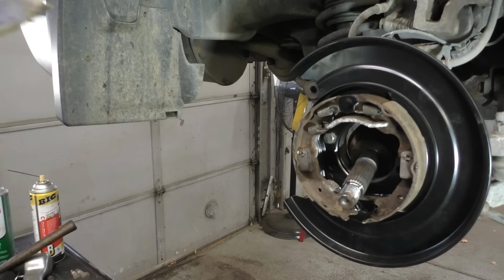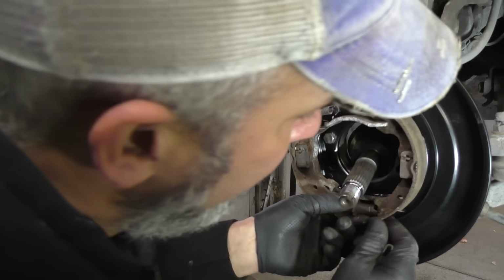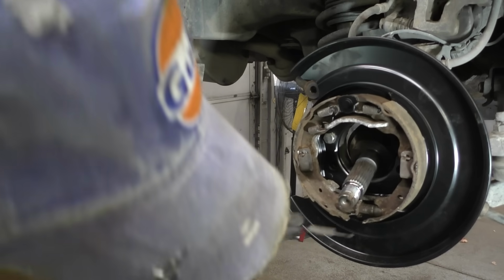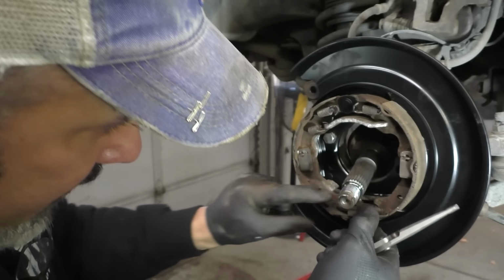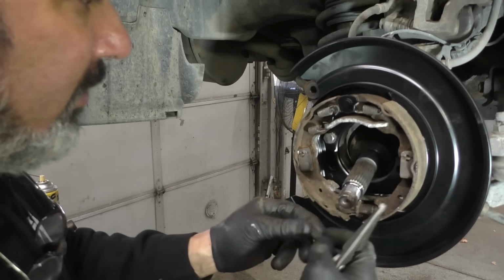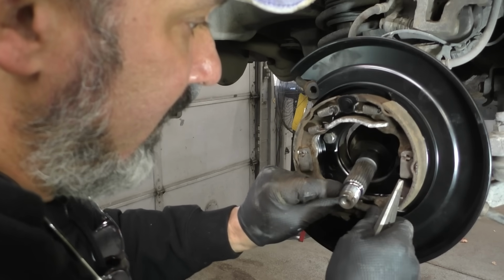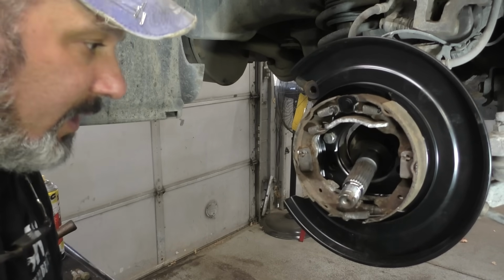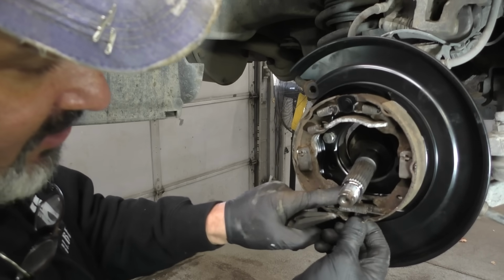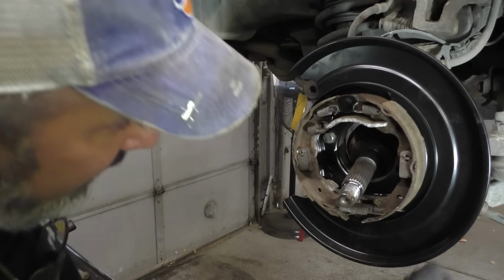Okay. That goes there, and that goes there. When we crank it up, it gets longer. And then, what is this in? I'm going to imagine that hook's in those little hookies, because usually the spring here is what holds the star wheel adjuster. I'm going to say it ends up going in those little reliefs there, but I'm not so certain. Let's go look on the other side. I'm going to take a quick peek. Way to go, Idaho. There we are. That keeps our adjuster from rotating. Okay, well, that was fun and exciting, huh?